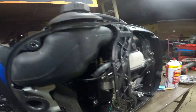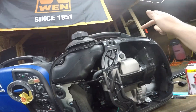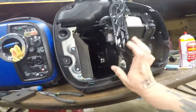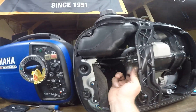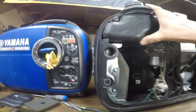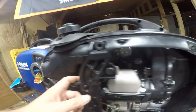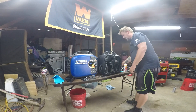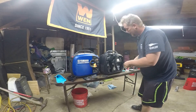Now I'm going to show you why I don't just pull it off and clean it — it's because I'd have to remove the other side and take out like 30 screws, plus the stepper motor on here is hitting against the gas tank, which is fully in there. I could probably get in there with an offset screwdriver, but that would be way too much time and effort. From here, what we can do is make sure the gas is in the off position — it is — and get from the bottom with the 10 millimeter on the bowl.